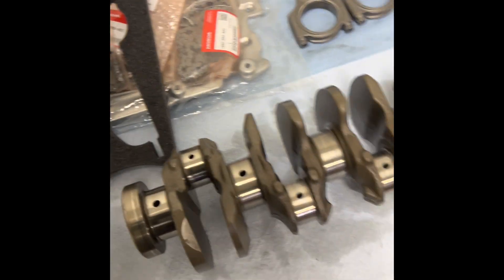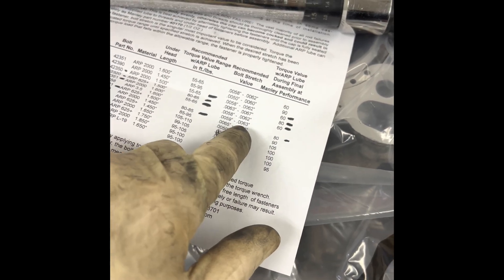You could even use a regular wrench — put this gauge on the bottom while you're assembling the motor, zero it out, and torque that wrench down until you get your six thousandths. It doesn't have to be converted to foot-pounds on a torque wrench. Just zero the bolt and go from zero to the target stretch. One thing: if your torque value is really off from what the sheet says, your torque wrench might need recalibration. If the range is 55-65 and you're getting a very different number, it might be out of calibration — but if you're hitting the stretch target, you're okay.